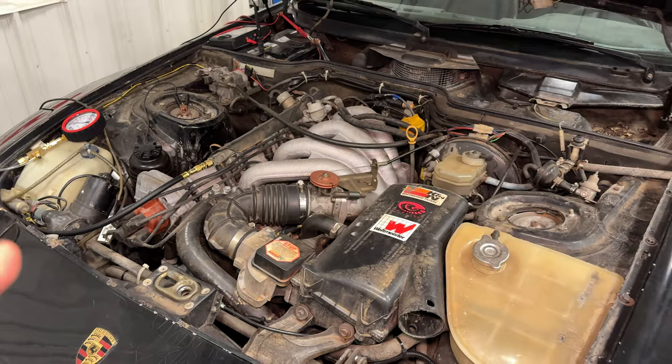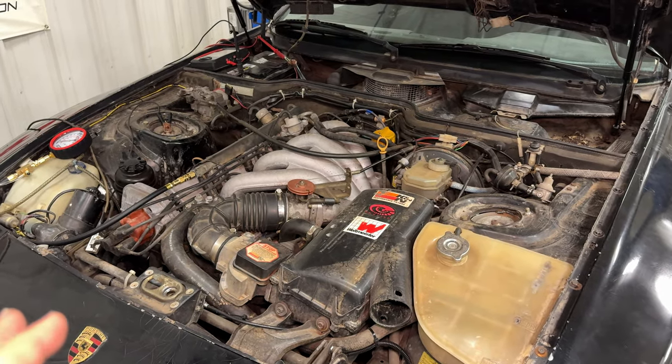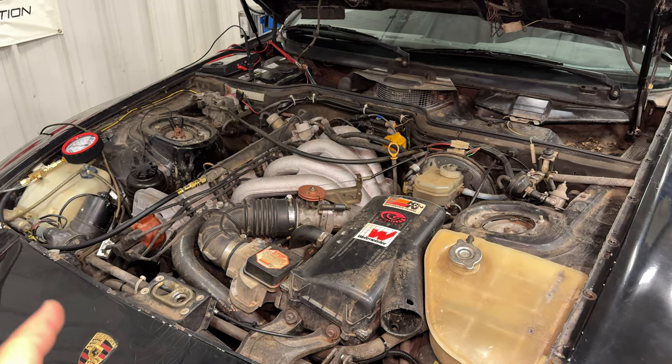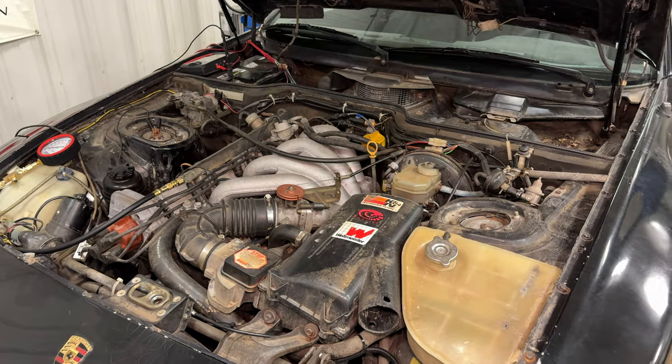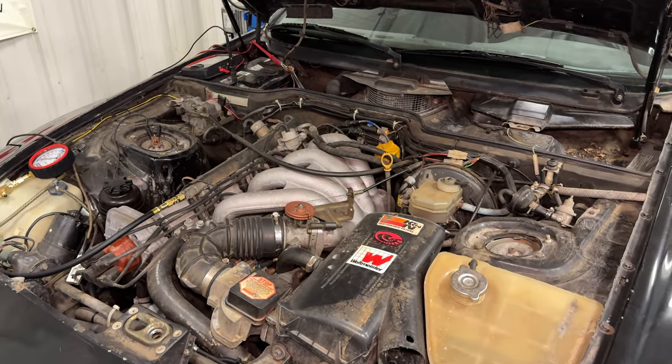What we want to do is try to replicate the later runs in the rally cross when the car is getting hot and it's not wanting to run at all. We'll see: is the car trying to cut its spark? Is it losing fuel pressure? Or what's just going on with it? And hopefully after seeing the results from this, we'll figure out how to fix this car.